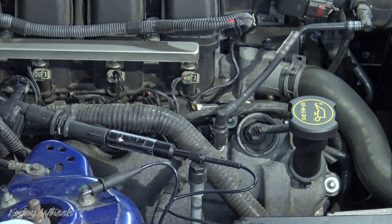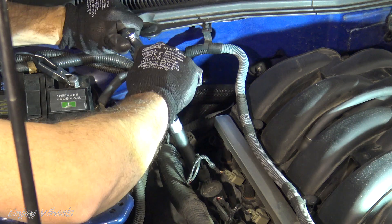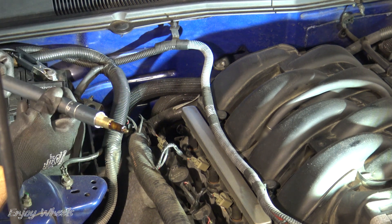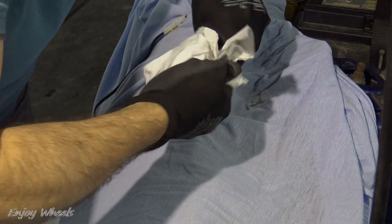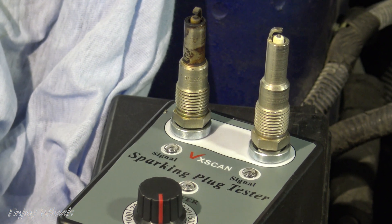But what is the issue with my car? Since the ignition coil is working correctly, now I'll test the spark plug. I remove it. Here it is — it is not in good condition and it smells like gasoline. I clean it before testing it. Now I'm going to test this spark plug with a spark plug tester. I put a new spark plug on the right and the one I just removed on the left — I also put a link to the spark plug tester in the description. The spark plug I just removed doesn't work at all.